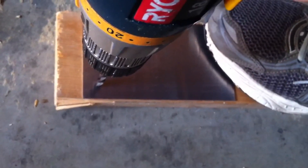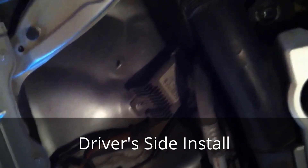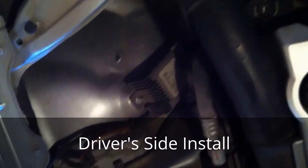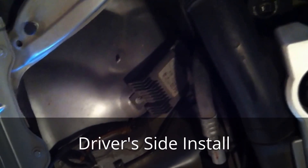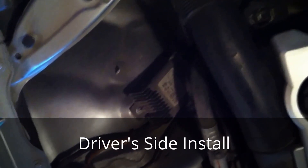Drilling a hole in the top left corner of the mounting plate to fit over the stud that goes on the driver's side interior fender. This is the interior fender wall of the Crossfire's driver's side. As you can see, there's plenty of room to mount the HID ballast, and you will be able to mount it directly to the headlight — at least the electrical connections — as there's the headlight housing on the front of the Crossfire.